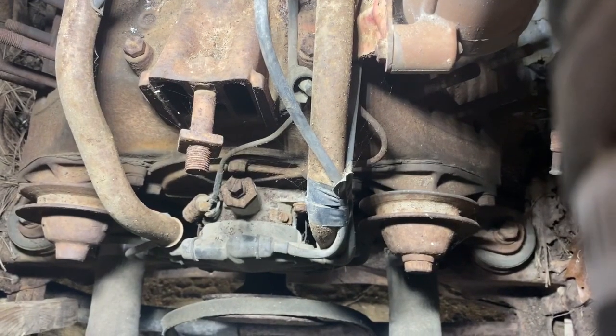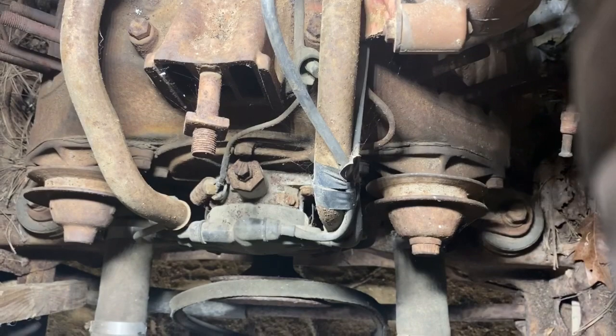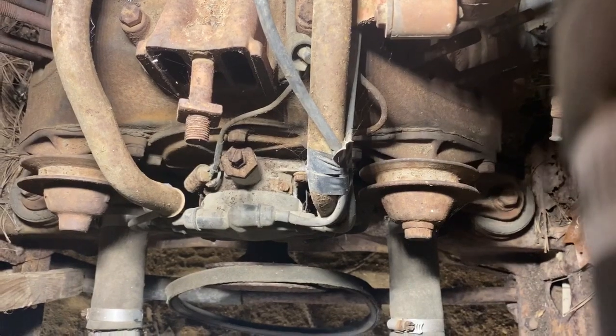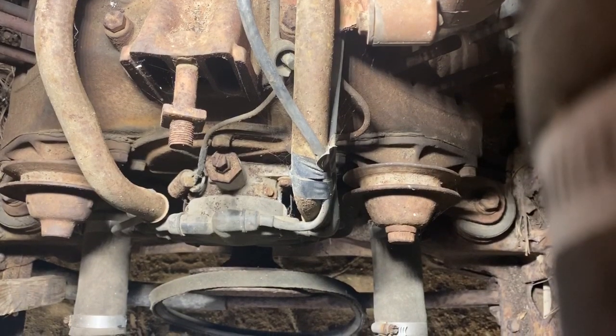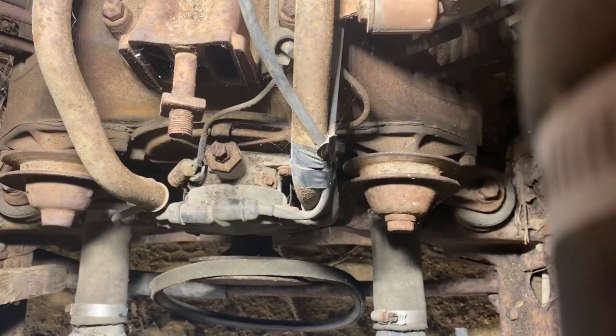Here's yet another flathead Ford distributor called the crab — what I consider the most common type for pre-1950s flathead Ford distributors. I could work on it here but wouldn't do a good job videoing it. It's all the same — the condensers are just in slightly different locations and the points are easier or harder to get to depending on the style, but it's all the same stuff, just different shapes.